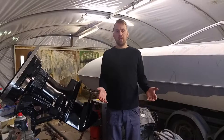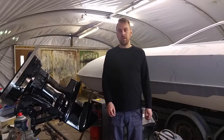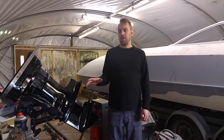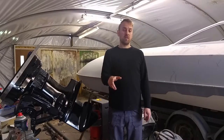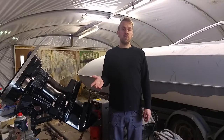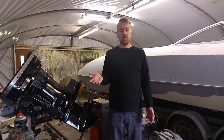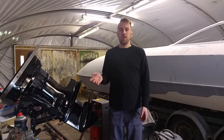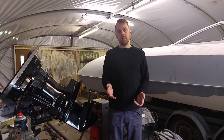Guys, thanks a lot for watching. I think we did pretty well today. The carb certainly looked really good. The new pistons look fine. The honing mainly went well. Piston one still has a bit of a scratch in it. Ideally, we would have bored it out and used oversized piston rings, but I don't want to go that far. So next episode, we'll put it all back together, maybe do a compression test and see what the results are.